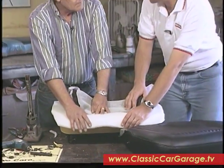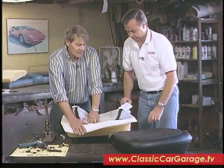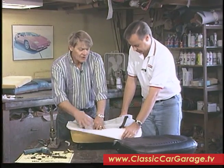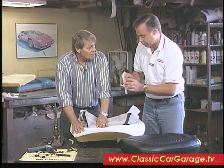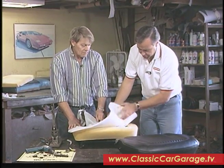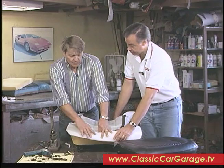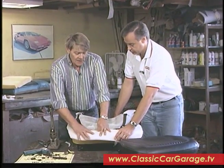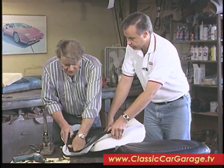What we're doing now is adding some additional padding to our seat bun so that it fits nice and tight. Sometimes it requires that — this is a very good kit, but I'm just trying to get it real nice and tight, so we're adding just a little half-inch layer to give it more tension in this area. This is something you can easily find at any auto upholstery shop or foam supplier. We've basically just cut a horseshoe shape so it'll fit right down in there. You could just put a little bit of glue on this to hold it in place — glue it right to your foam bun. After it's all in place, you can just slip your upholstery back around by slipping your front corners over first.